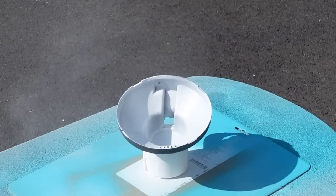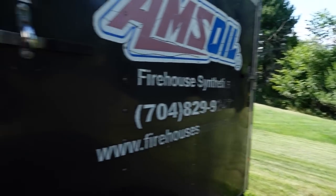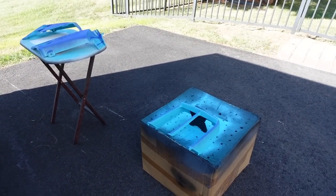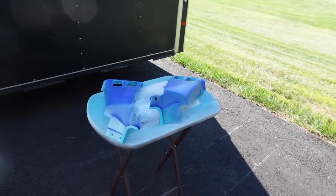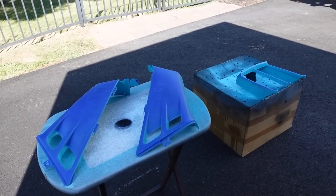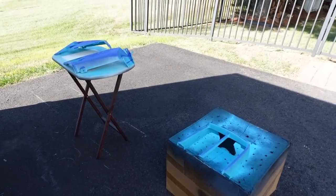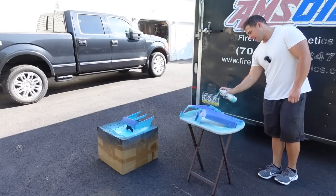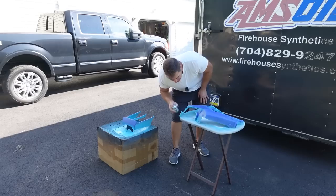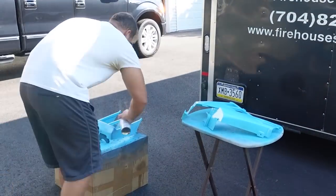I flipped over our tank covers and the radiator cover — it's been about an hour and a half for the underside to dry. Now we're going to do the top section. I've got them laid out behind the trailer which is blocking the wind, with a nice area of shade. I'm going to do nice, very thin coats — probably between four and six thin coats until it looks nice and even. Then I'm going to go over it with a clear coat, probably two or three coats of crystal clear, which will protect these and give them a nice long-lasting finish. I'm setting a timer and waiting 15 minutes between each coat. I like to get the difficult areas first, then do the large flat areas last — that allows the paint to lay a lot more even. Be patient, thin coats, and it'll turn out best.